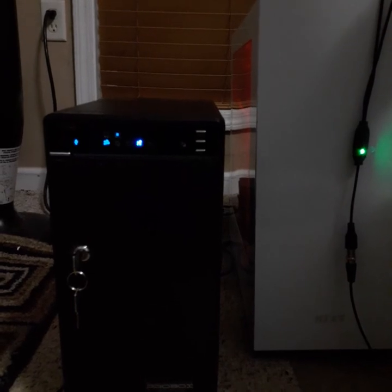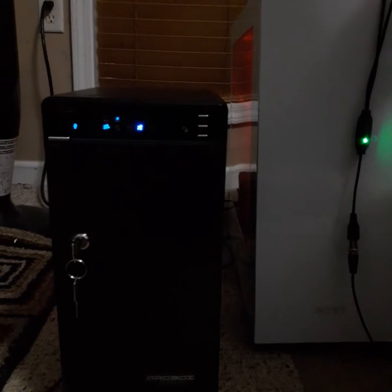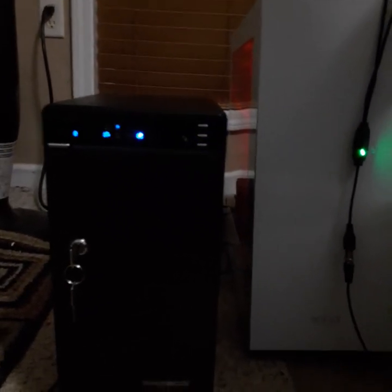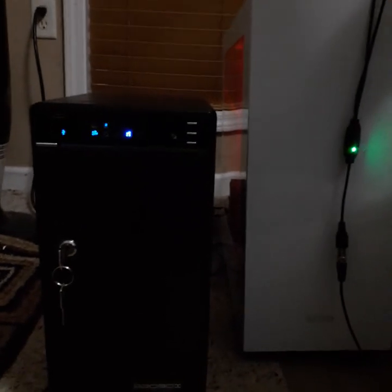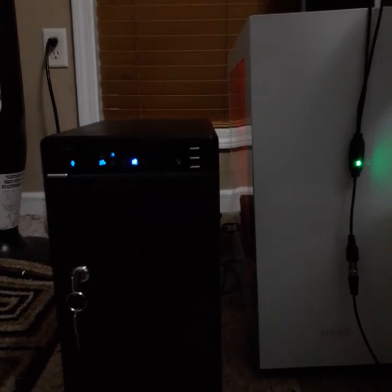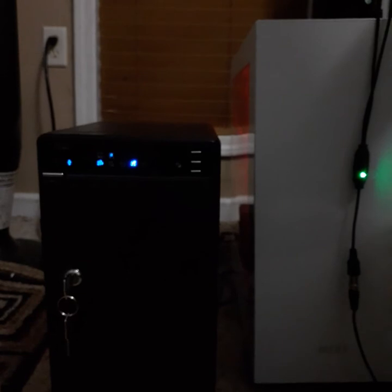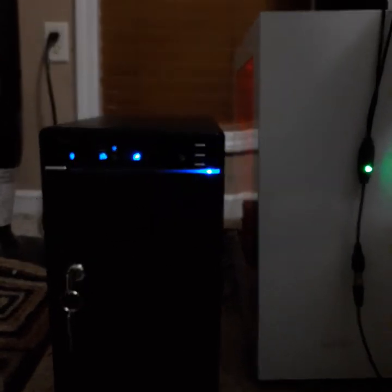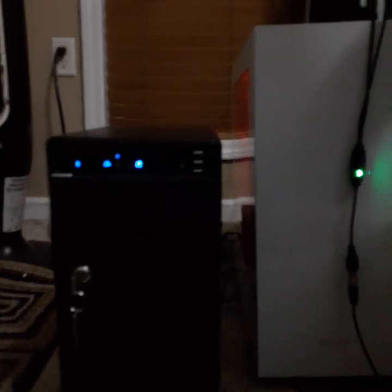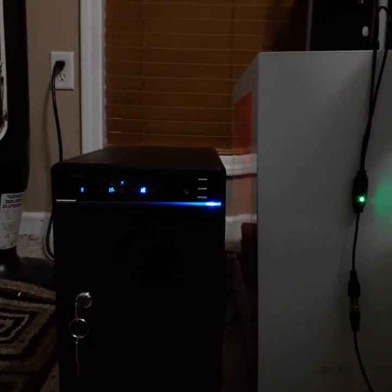What I did was, over time, on Prime Day or something like that, since I'm in the US, I would gradually get the drives one at a time, and make sure they were SATA internal drives, because they have to be mechanical drives. They cannot be solid state for this enclosure, because this is an older model. The newer ones down the line may support that, but I got mine one at a time and basically put them in. They don't all have to be filled at once.